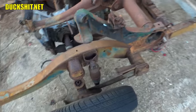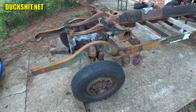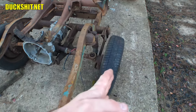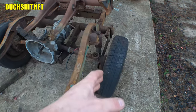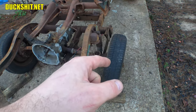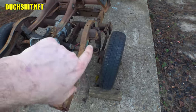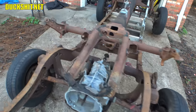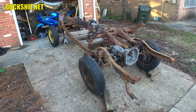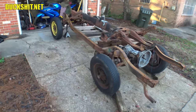This will be an IRS conversion also. I don't like swing axles — swing axle stuff rolls over. The suspension is the issue. The way these wheels twist instead of just going up and down — the swing axle ones do all kinds of wobbly stuff. What happens is when you turn and all the weight goes onto the outside corner, that wheel will want to smash up under the car and the outside wheel will want to tuck under, causing the vehicle to want to flip over. Tall vehicles with swing axles on a bus, for example — split window buses like to roll over. I don't want anything on a bus chassis that wants to roll over, especially if I'm building this up.